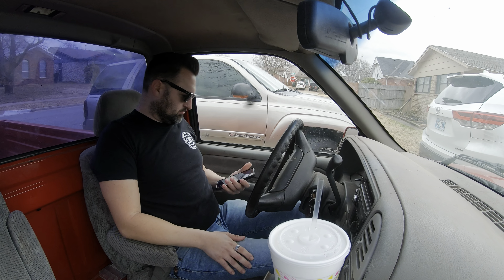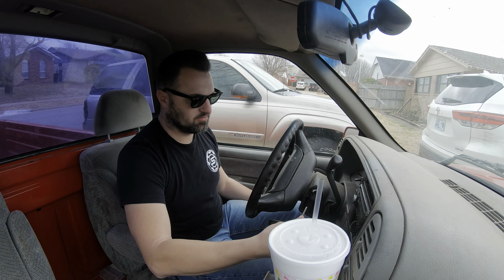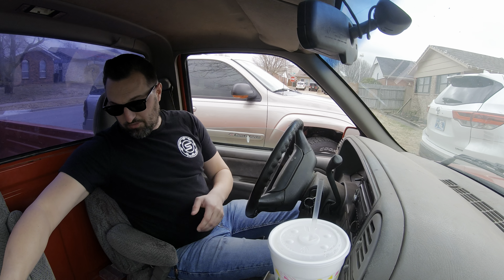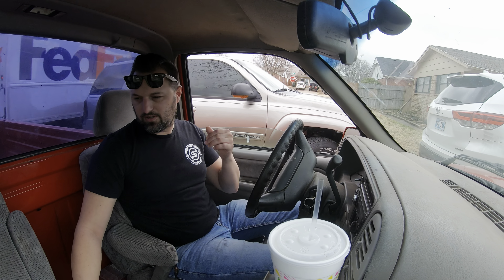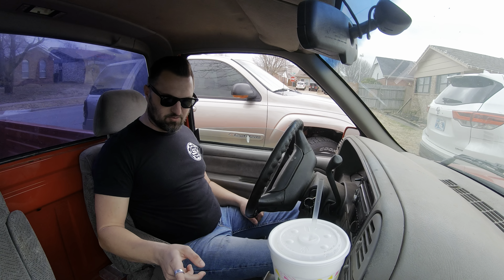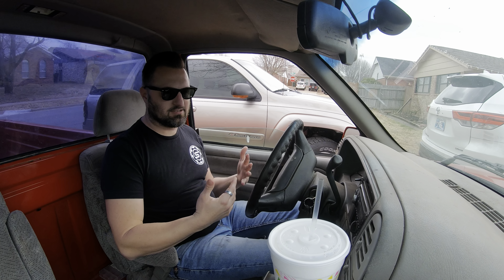Day two. Going to finish this thing up and plug the trans a little bit more — I think it's a pressure issue. Talked to the customer last night. He said this trans only has 5,000 miles on it. I didn't see anything wrong with the tune either, so I even sent it to another tuner buddy of mine — a second set of eyes. He didn't see anything either. I guess we'll just bump the pressure and see if we can get it to that firmness. I'm going to swap out that PCM and see exactly how much firmness the customer was talking about, because my level of firmness compared to somebody else's is probably different.